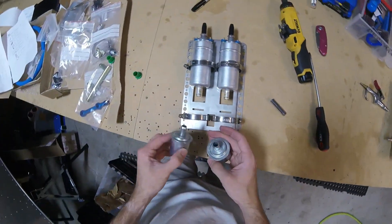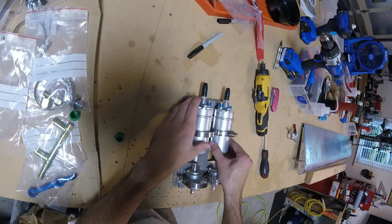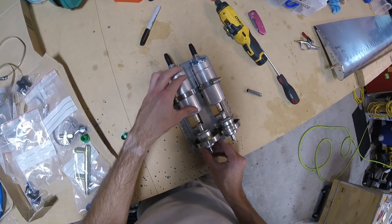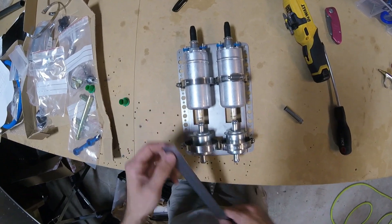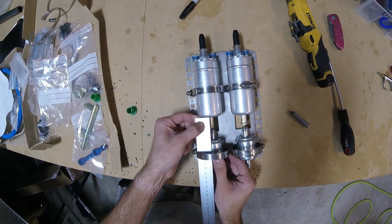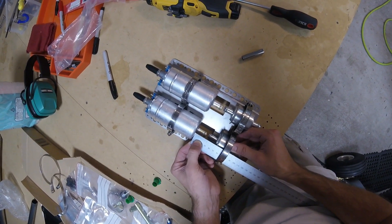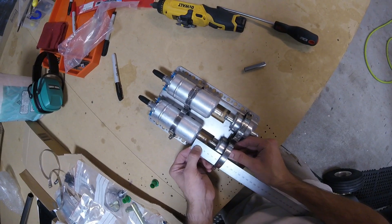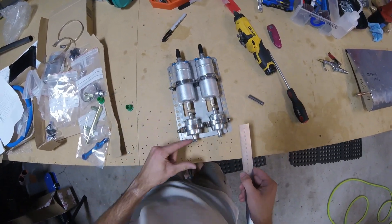Pre-filters, or coarse filters — take these caps off. There's some kind of goop, maybe that was gluing the cap on. It's nice that they have these little cutouts for the rings here and here on the pump so you can see where it's supposed to go. This one doesn't move much either, so let's have these both kind of towards each other. Then we're supposed to measure the distance between these — right about 48 millimeters, maybe 47. We'll cut four pieces, 45 millimeters or so long: one here, one here, one here, and one here.